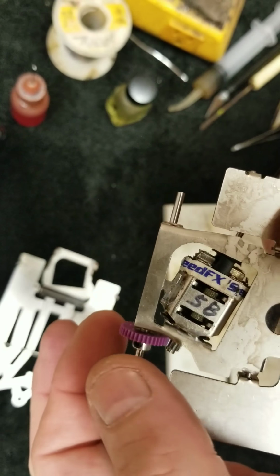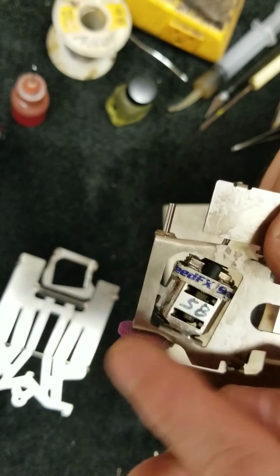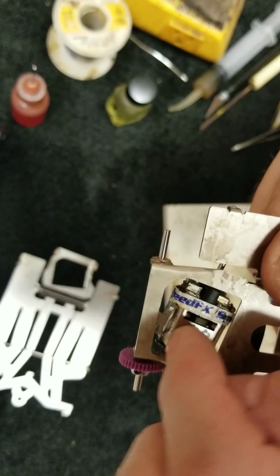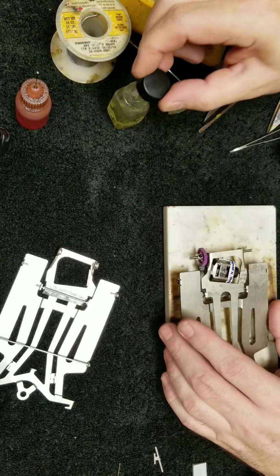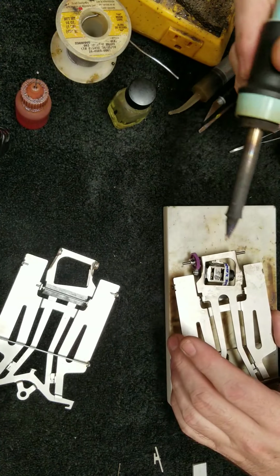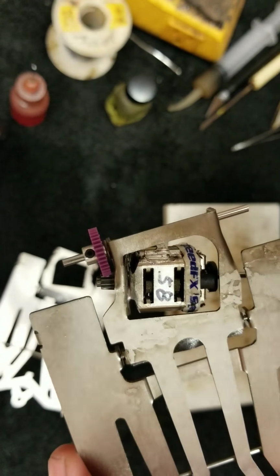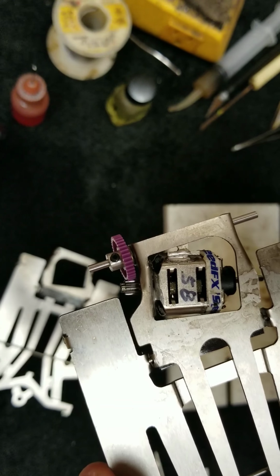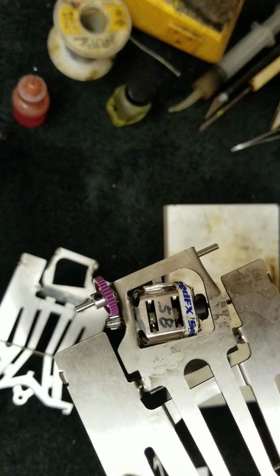So that, like I said, start with the smallest spur gear to solder your brace in. Then if you go bigger, you'll have your gear mesh, because if you had done this with a 37 and had that up against the motor and then went to a 35, you could never get the motor back to get your gear mesh. So basically, again, a little bit of flex there. Get you a pretty good size ball of solder on your iron, and you fill in the gap with solder. And then once you've figured out what you're going to do for gearing at the racetrack on a particular day, you got to come back and re-solder this, and you want to fill this all the way in with solder, and you shouldn't lose your motor in a crash.